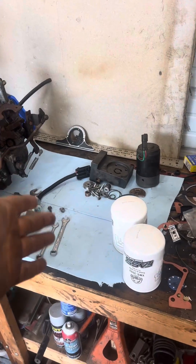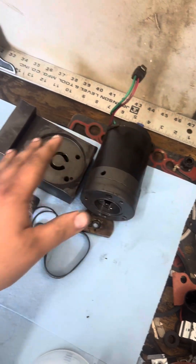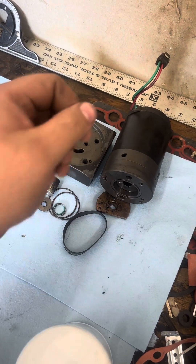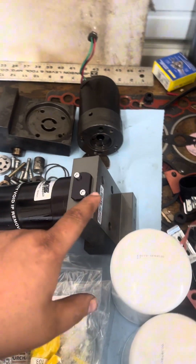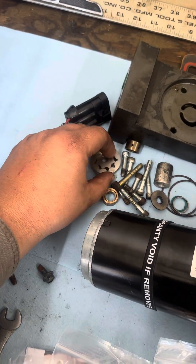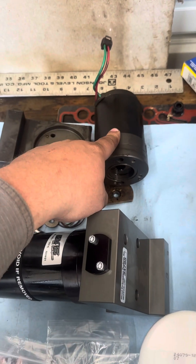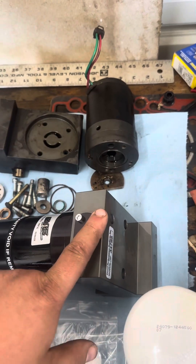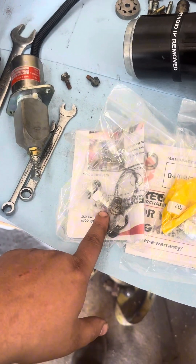Either way, they reached out and wanted to help me get properly set up for this P pump. After I told them what pump I have, they were pretty sure that the 100 gallon per hour pump would not last for a long time running on straight waste motor oil. So they sent me a brand new 145 gallon per hour pump — it has a different size pump in it, geared up so it can push more pressure. This one is designed for high pressure, which is why they sent it, along with all the hardware to change the return pressure to 45 PSI for the P pump.